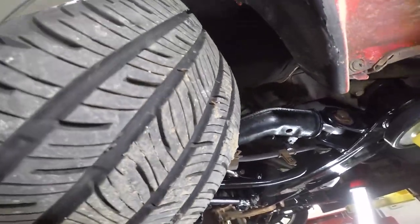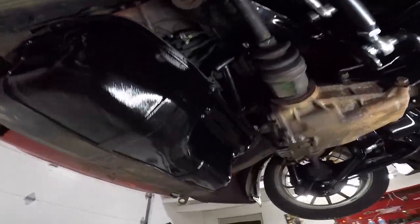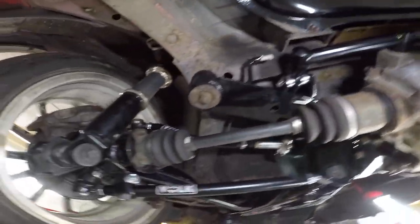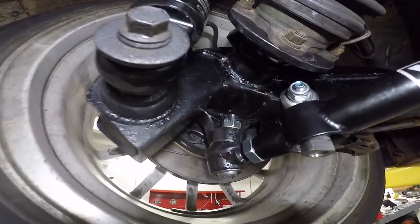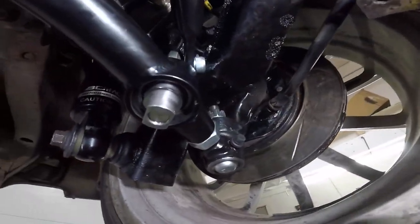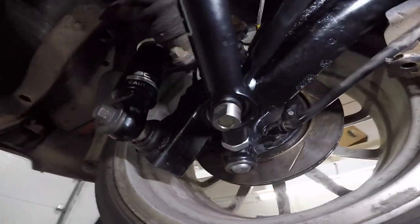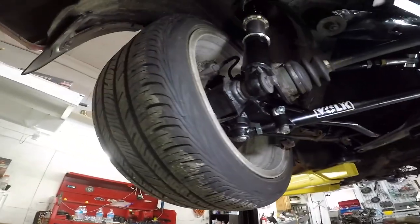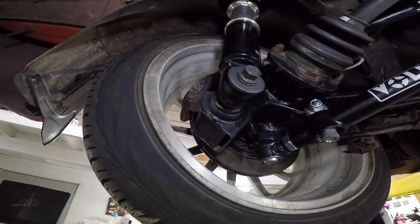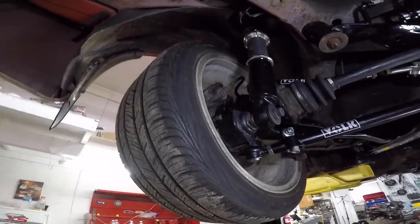So there's everything I did back here. All this is torqued down, everything's ready to go. You can look up the torque specs - I don't remember them off the top of my head, but everything's torqued to spec. I do not have cotter keys in - when it's torqued down to spec the cotter key hole is actually above the castle nut, so even if I put a pin in there it wouldn't do anything. These parking brakes are not fun. I think I did a video on them a long time ago. If you really need to know how to do it you might be able to go back and find that.